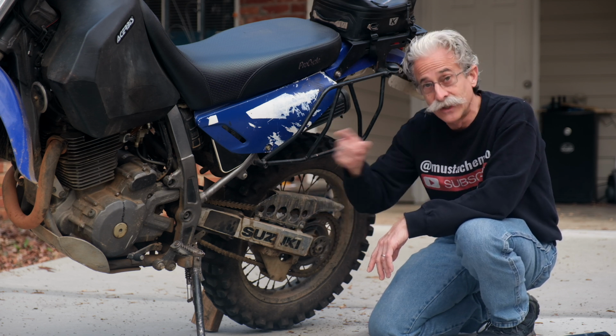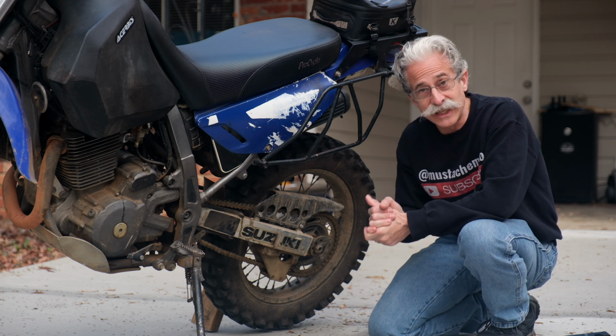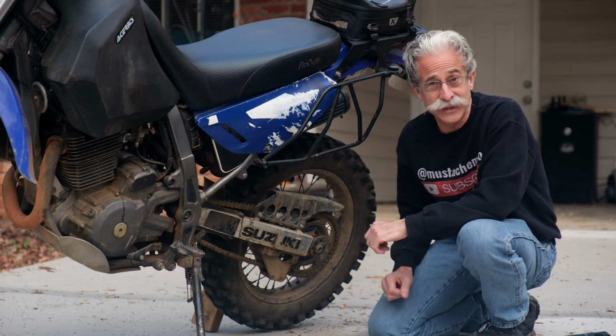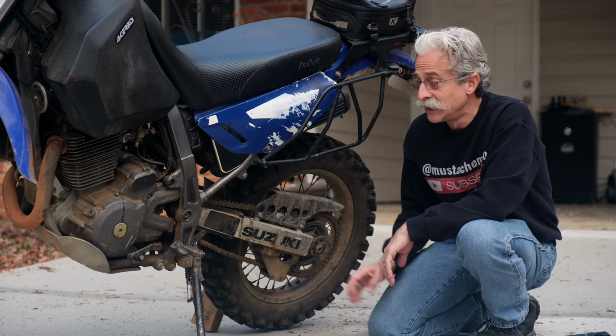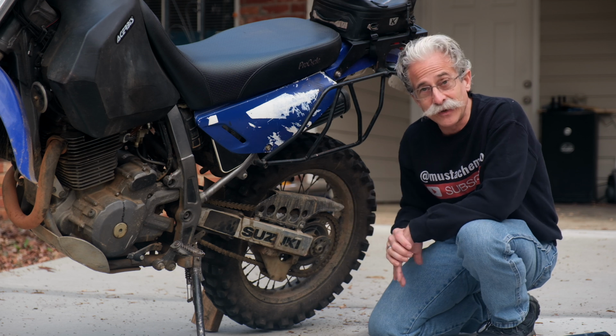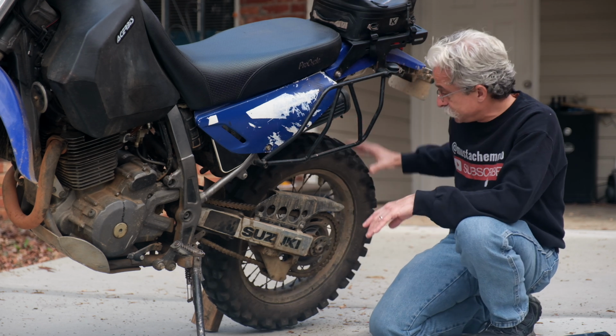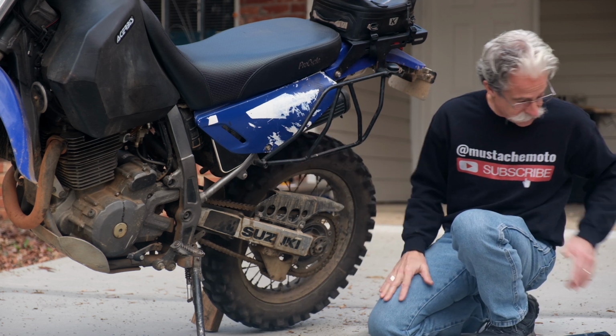First thing you do is go ride around in a circle, go around the block, you know, warm the chain up. Basically use it as an excuse to get out there and have some fun. So once the bike is good and hot, the chain is warmed up, it's going to accept that grease, the spray, a little bit better. I've got this up so that the wheel's rotating.